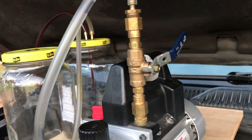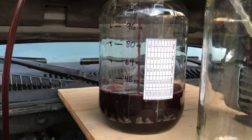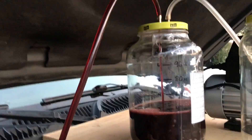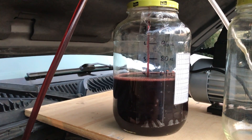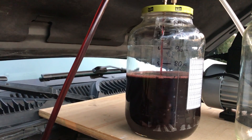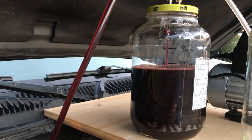So as you can see I just have a small metering of the vacuum. See how easily it's flowing - at this point I'll turn off the vacuum, let the existing vacuum kind of do its job, and continue sucking transmission fluid. I've seen many vacs where the fluid might be thicker, but this will suck any kind of oil, heavier, denser stuff, without pumping a pump multiple times.